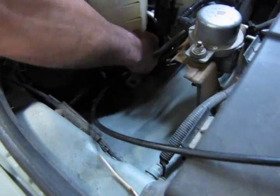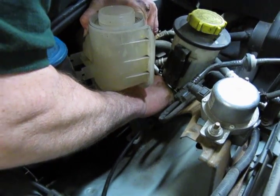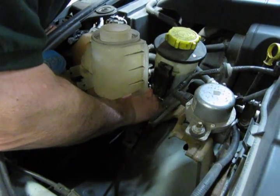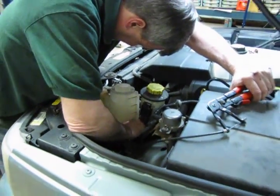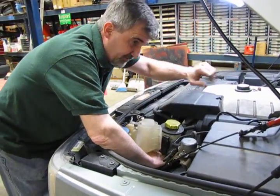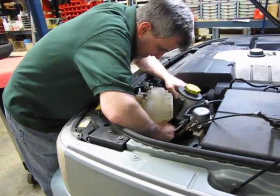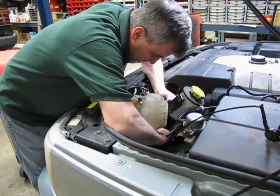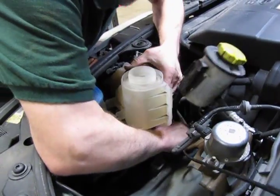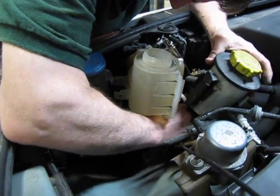So we're going to manage to run that down and hook up to one side of the clamp, and then hold the attachment down level so that as we squeeze, the other side makes contact. And this has a stop on it, so when you fully squeeze it, it'll lock, which will hold that clamp open. So now we can just get down in there and sort of work it off the edge, the nipple of the body, and down the clamp a little bit. Basically get the end of that hose exposed so that we can put a clamp.